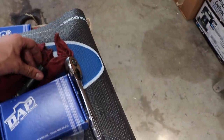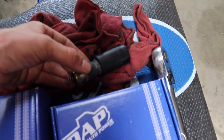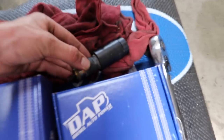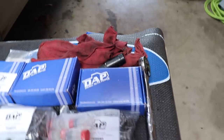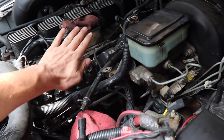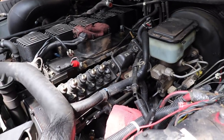I took this special socket, which is a special type of socket you're going to need. I thought I had one in the description of the video that I did this on the first time for Nasty Red, or in the mod list, but I don't remember for sure. Anyways, I put it on there and wiggled it down a little bit until I knew it was on there and lined up right. Then I took a hammer and tapped it down until it sat all the way.